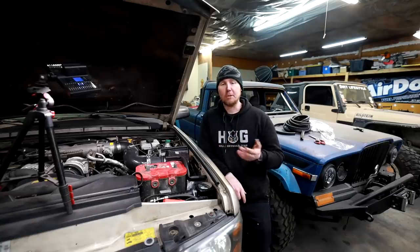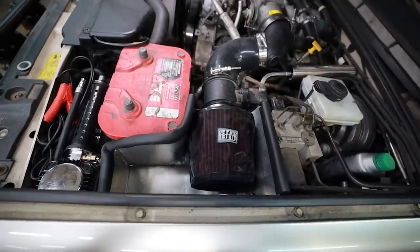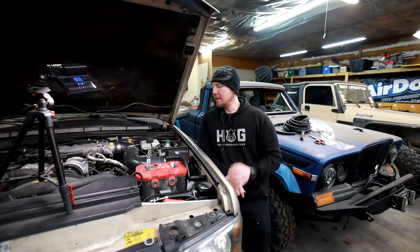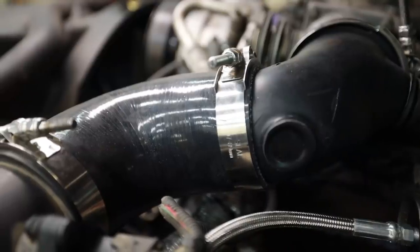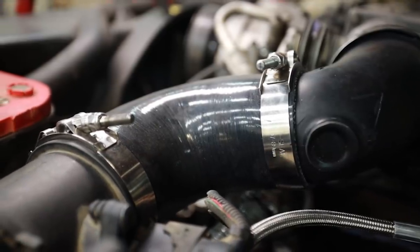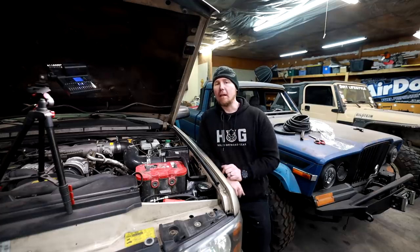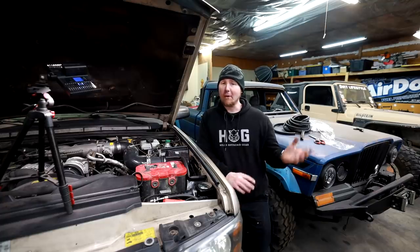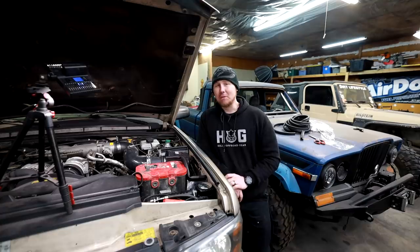I'm a little embarrassed, but here you go — it's our finished product. I think this is my first full-on failure since I started a YouTube channel, but this is just how it goes sometimes. Looking at the glass half full: it's going to sound pretty dope because of the stuff we removed on the factory intake pipe, so it's going to sound like a V8 when I get on it. Also, this style filter, although not ideal for most people, will work where I live because it's rainy all year round in Western Washington. We don't have a lot of dust, so the particulates that easily bypass a washable cotton-style filter won't really be much of an issue for me up here.